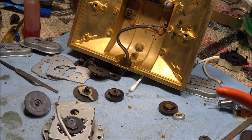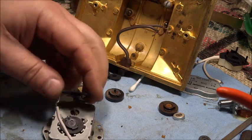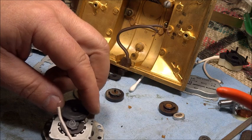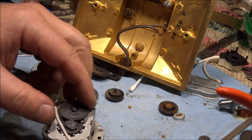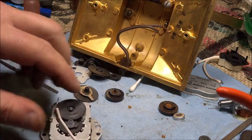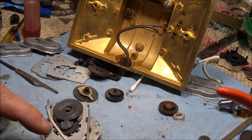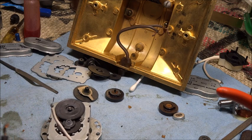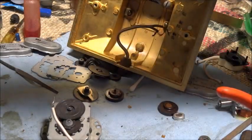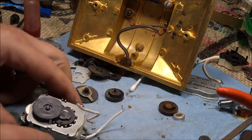So this little motor, it'll go whatever direction it starts moving at, and so it needs this one-way clutch to tell it which way to start turning. So if it starts spinning the wrong direction, it stops and starts spinning the other direction, so then it's freewheeling that way. So I think we're ready to just can everything back up again. And try to get it installed.